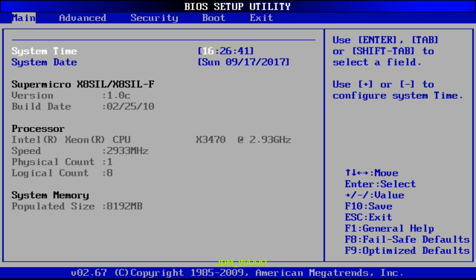So when you're running 4-pin PWM fans, you plug in quite a few fans, and all of a sudden all of your fans are spinning up and down — going from full load, 100%, down to 50%, 40% PWM, and then back up. Long story short, your Supermicro board thinks that your fans are failing. And it's wrong.